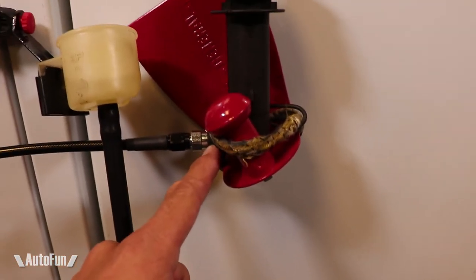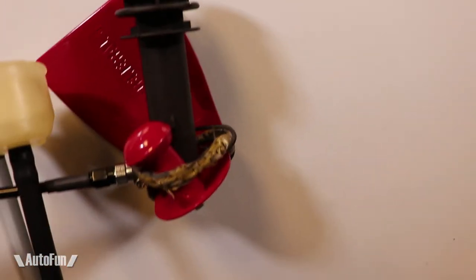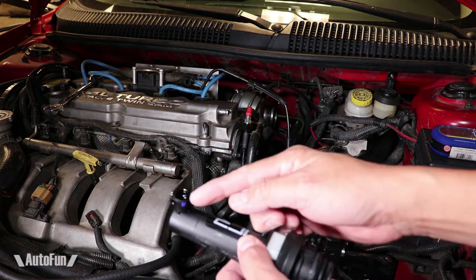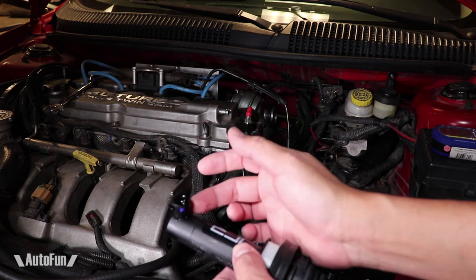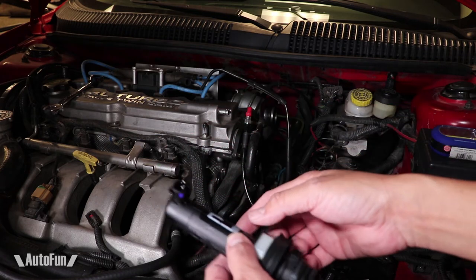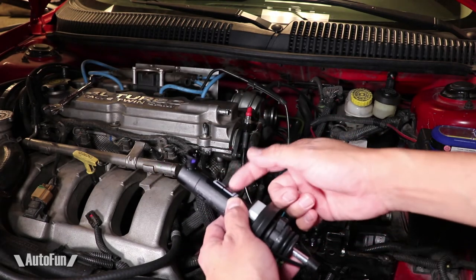What I'm going to do now is very carefully disconnect this by removing the screw, then cap off the line so I can take this setup and install it in the car before I install the slave cylinder. I've also pre-filled the slave cylinder with fluid. I tap, tap, tap to get the bubbles out, add more fluid, then tap more, more bubbles come out, add more fluid, and repeat over and over until it's filled with fluid and free of bubbles. This is going to help with the final bleeding process.